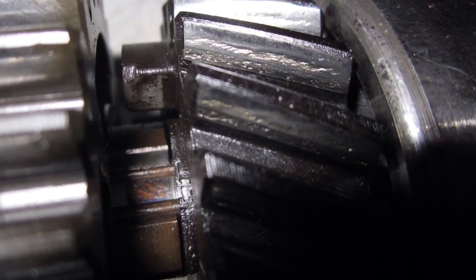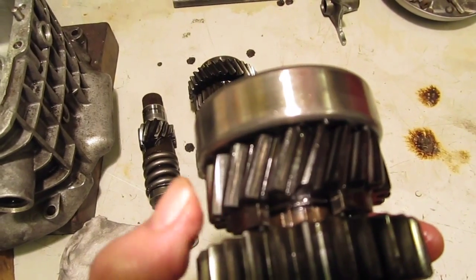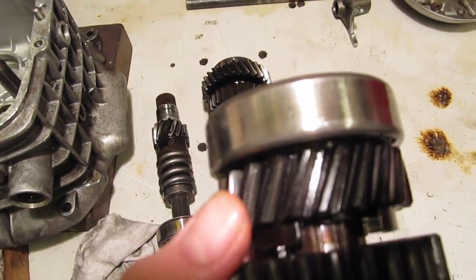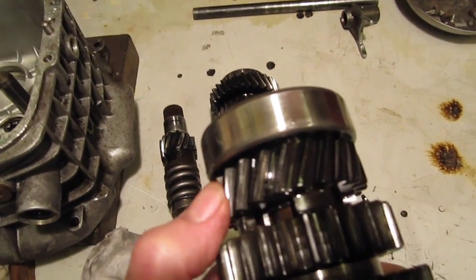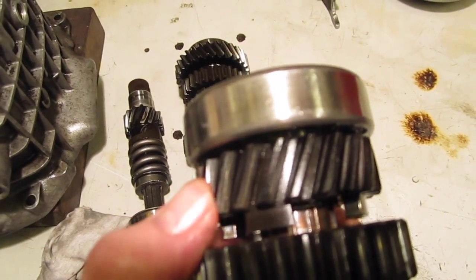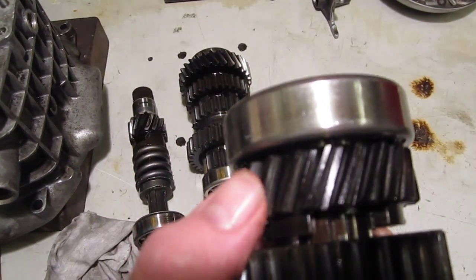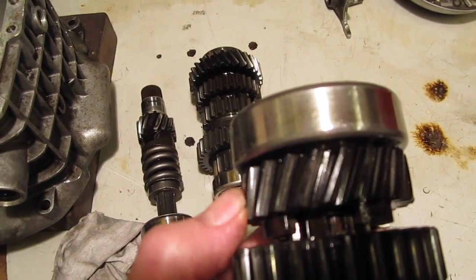This is the output shaft and again showing a lot of signs of wear. There is a gear available which gives you a 5% higher gear ratio, so you get a consequentially slightly lower engine rev for any given speed in top gear, and I can get one of those. I've got one on my bike. Personally I don't rate them that much, although strangely enough they are cheaper than the genuine replacement BMW gear. But having had my gearbox apart since I've put one in, I've noticed that the gear is wearing and it seems to be wearing faster.